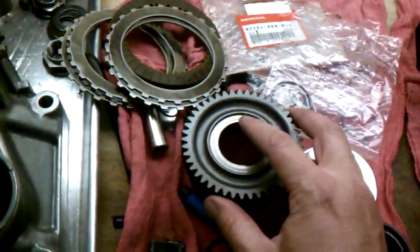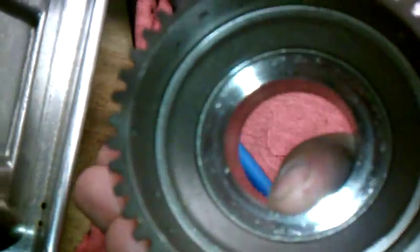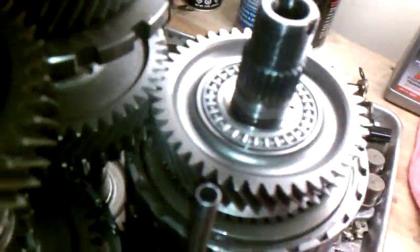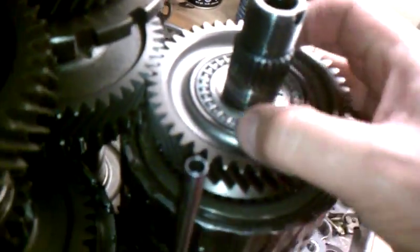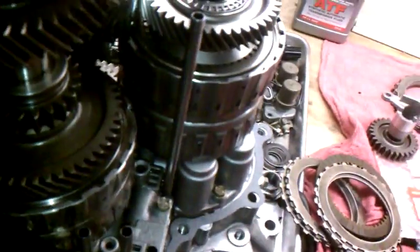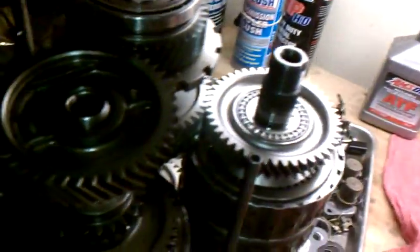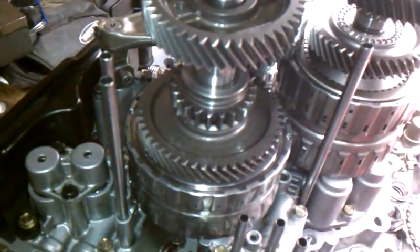This is the MDWA, and I had to replace the second gear. Here's my old second gear — it has some burning, it's chewed up. This thrust surface is supposed to be smooth, but it's all pitted. What had happened was this thrust bearing had come apart; all the little needle bearings were still retained but every which way, so they were chewing that up. You could hear it too — the van had a kind of whine coming from it, so you knew something was wrong.